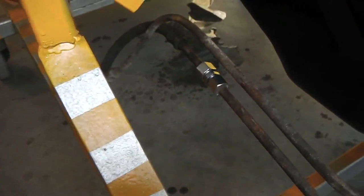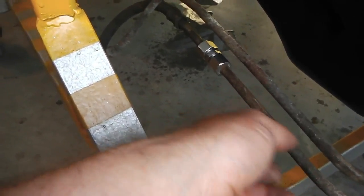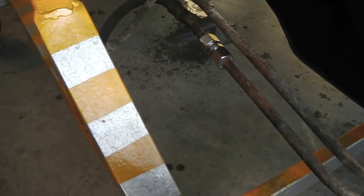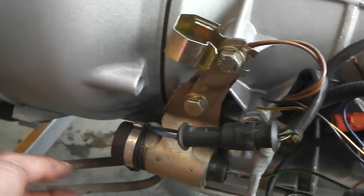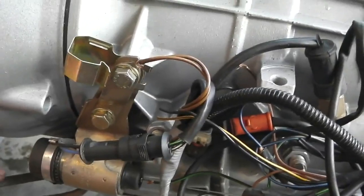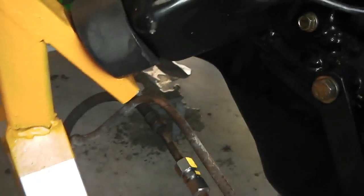In fact, believe it or not, they actually need it to be connected to your radiator in colder climates, certainly. The fluid in here, if it's very, very cold, the gearbox doesn't behave tip-top. It prefers to be at its preset level. That was the reason why they let the fluid go into the bottom of the radiator here, which is a cylinder inside the radiator. It's actually not part of the core. It's completely isolated. If you take one apart, which I did, or I got my radiator guy to take it apart for me. Just bringing you in now, hoping you can see that at home on YouTube.